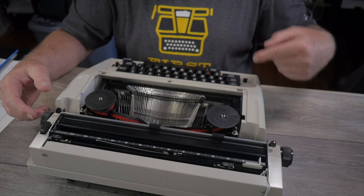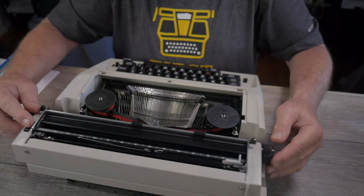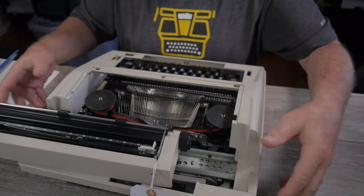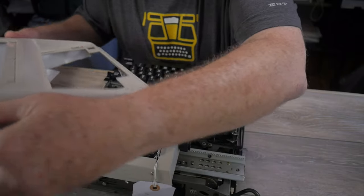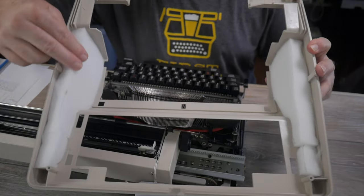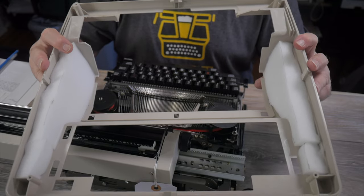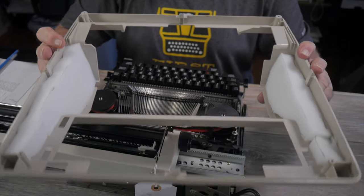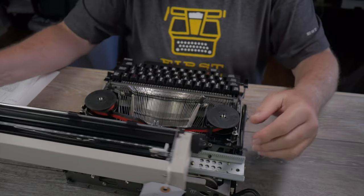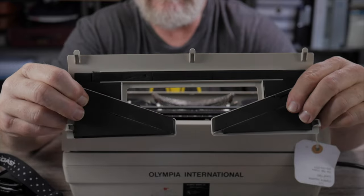In order to get the top shell off the chassis, the power switch has to be on to unlock the carriage. Move the margins all the way out, move the carriage all the way to the right. I've also added urethane foam to the insides of the upper body shell — the idea being to add as much foam as possible without interfering with the mechanics. I also put dense foam on the inside of the ribbon cover.